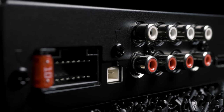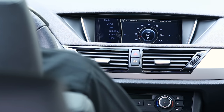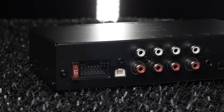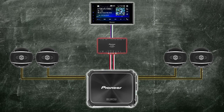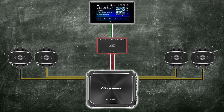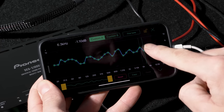The 48-bit DSP is incredibly useful in situations with vehicles that have factory navigation, rear seat entertainment, and integrated climate controls, making upgrading to an aftermarket stereo impossible or really expensive. A DSP allows us to independently control different aspects of our speakers in our system. The DSP becomes the central processor in our audio system by connecting it between the amplifier and head unit, and the audio signal goes through the DSP and is sent to the amplifiers, allowing us to modify the signal before it reaches the amplifier.